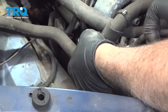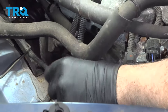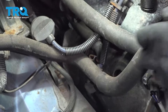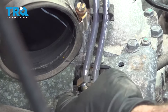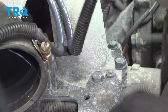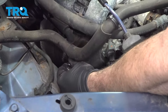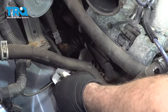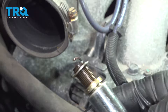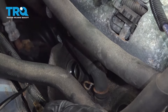We're going to use our wire pliers here and grab that front boot, pull that out. Do the same for the rear. Remove our wires from our retainer here. Now our spark plugs are soaked in oil. If you're experiencing something like this, it's usually going to be the O-ring seals on the valve cover — that seals the engine oil from getting into the cylinder where the spark plug sits. Just pull that valve cover off and replace those seals.